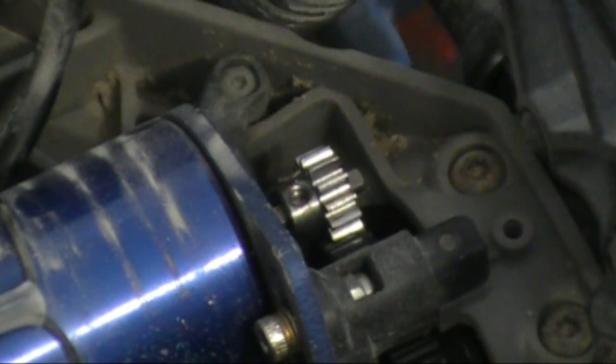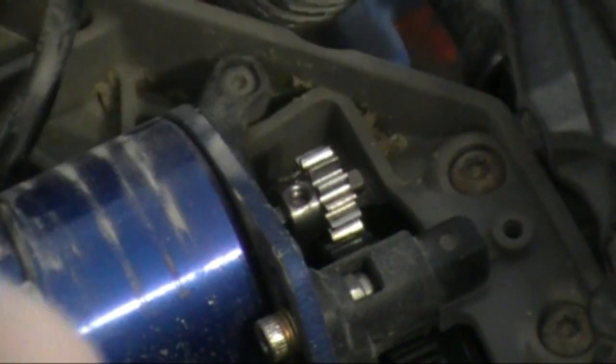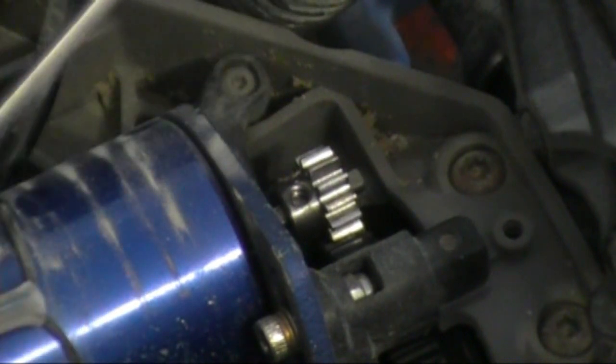I've re-centered it and got the screw out. I'm going to put some Loctite on that screw — always put some Loctite on that pinion gear screw and tighten it down, because then it's really a pain getting that thing off. I'm going to find my Loctite and put some on here and tighten it.